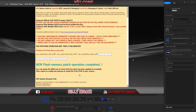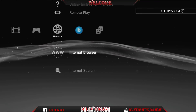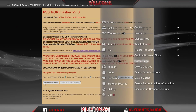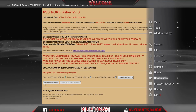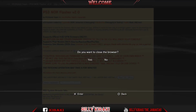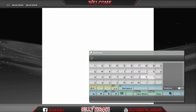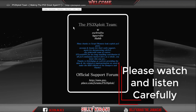So now that we're back on the PS3, let's close the browser, and we want to enter the browser again. Press OK, press triangle, go down to tools, go down to home page, use a blank page, go back in, triangle again, go down to delete history, delete all. Now let's close the page again, and let's go back in the browser one more time. Let's press start, delete this, type the exploit page name again, start, press OK, and let's go back to dumper.